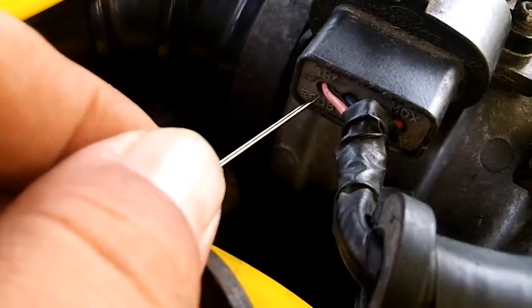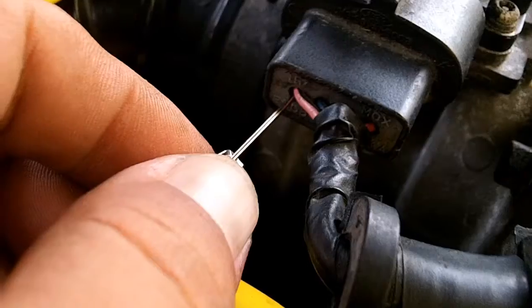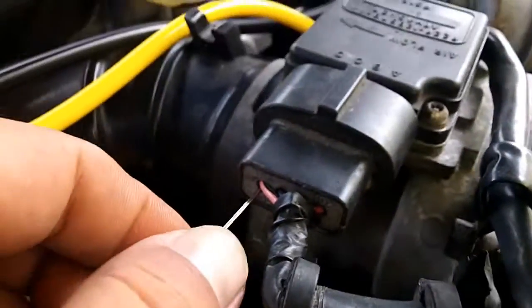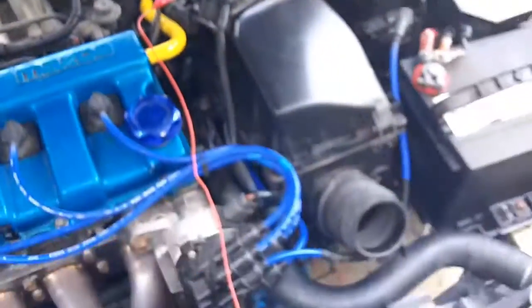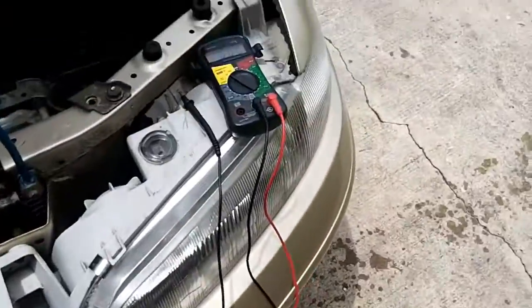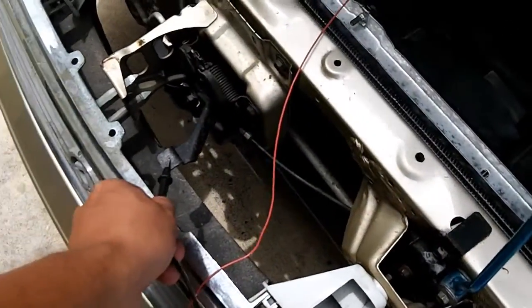The T-pin does not go into the wire. There is a rubber grommet surrounding the wire, so you have to get this through the rubber grommet, which acts as a waterproof seal, and then you just kind of stick that in there. Make sure that no other metal is touching, especially down on your lead here. You would connect this up to the positive lead of your multimeter.